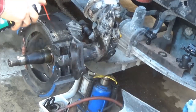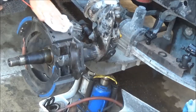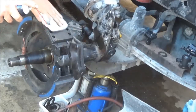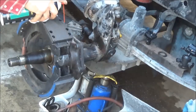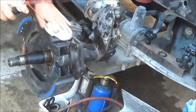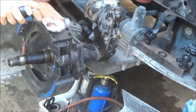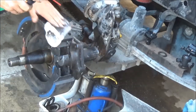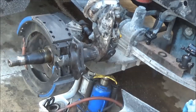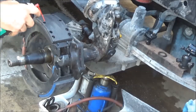I'm going to go ahead and start cleaning up the oil on these brake shoes. I'm not allowed to do this in an open shop, but at home you can do it. They want you to replace them, but these are brand new shoes — just put them on a few weeks ago. When you do this and clean the shoes with brake cleaner, don't forget to clean the drum too.